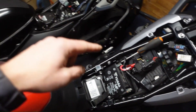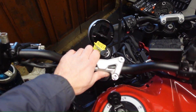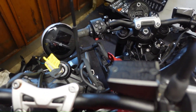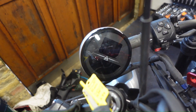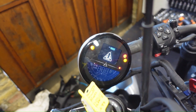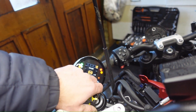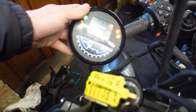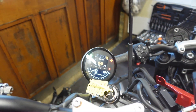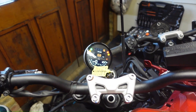I've switched over the ECU - it's under there, I've put it in place. The key from that bike is connected up to this bike, and the clocks and ECU on this bike are now from the donor Trident. I'm going to turn the key and hopefully we will hear the ECU and the fuel injection fire up. Fingers crossed - first time... no, nothing. Okay, so that's not good at all. There's a fault with the ECU - I don't know why, it might be the lock set. I'm going to keep digging.